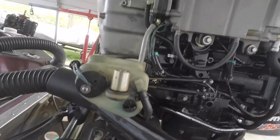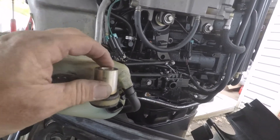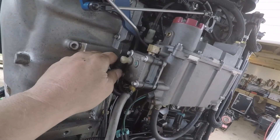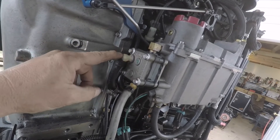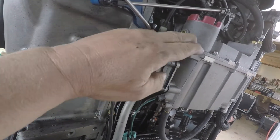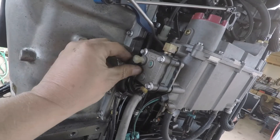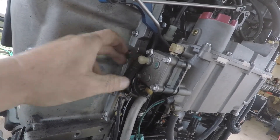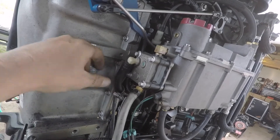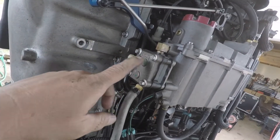I dropped my bottom cowling again and now we got this loose. Just three bolts and it's got this little spacer — this bolt's a little longer. That gets us to where the fuel pump is. So I loosen the outlet line. This is our out, and this is also our out. So it pumps a little fuel down into this intake and then it pumps it into here too. I'm guessing this kind of oils it. This is tight so I'll just get a pair of channel locks and move it back and forth — it'll pop off. If it doesn't, I'll cut it.